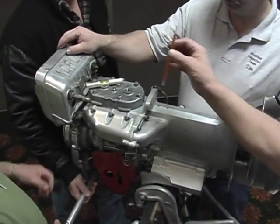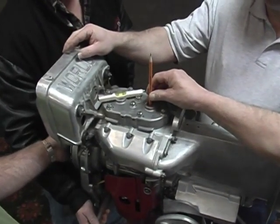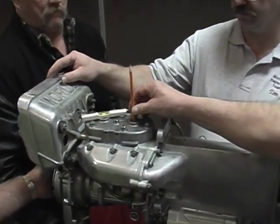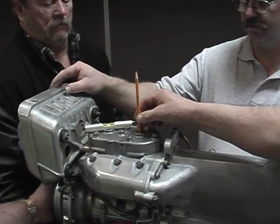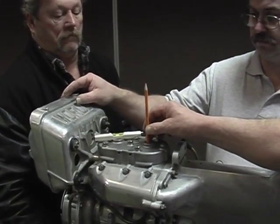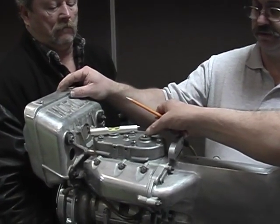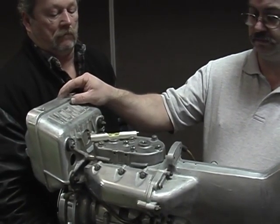I'm now going to take an object, a thin one. We're just going to slide it down inside the spark plug and try to determine top dead center. Right now, this can be done as a rough setting. There's no need to get precise right now. Just get it close. See, there's low, and there you can see it coming up to TDC. Because this is measured at TDC, and you put enough fluid in to fill the combustion chamber plus the spark plug threads right to the top of the hole. When we hit flush, that will be the CC of the motor.